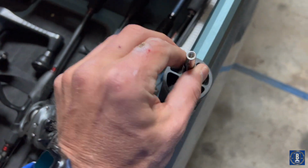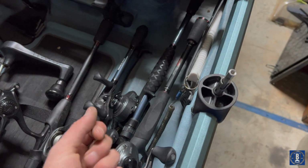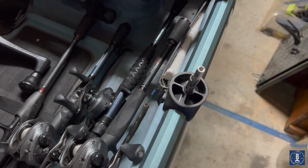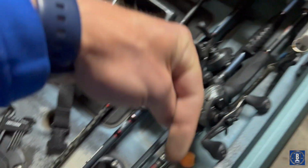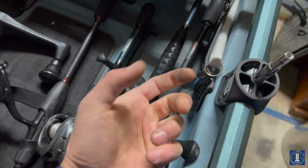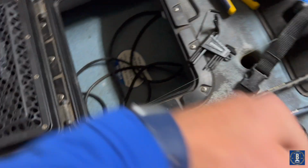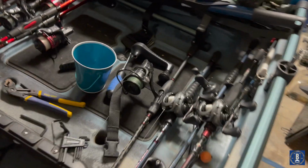Number 2, I've got the cap off now. And basically this just sits in this here. And so at the bottom of this is like a black housing. And there are 3 Allen wrench screws at the very bottom. That is going to be a pain in the rear to get to. Because I've got to take that housing off, and then the belt runs through that housing down a tube, and you can see where the tube ends right here. That's your tube. So the belt's in there. Let's see if I can show you the tube here too. There you go. Your belt is sitting inside there. So what I've got to do is take the 3 Allen wrench screws off the bottom of this casing, and then that whole tube assembly should come out, and I can replace the belt. But getting to the bottom of these 3 screws is what's going to be the pain.